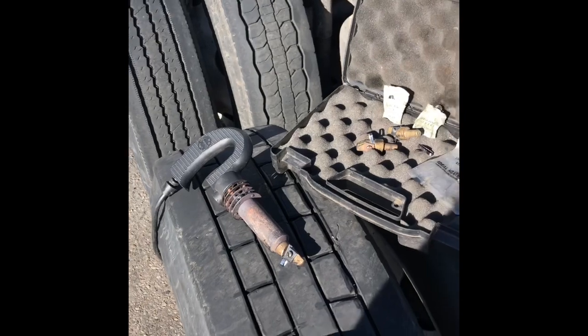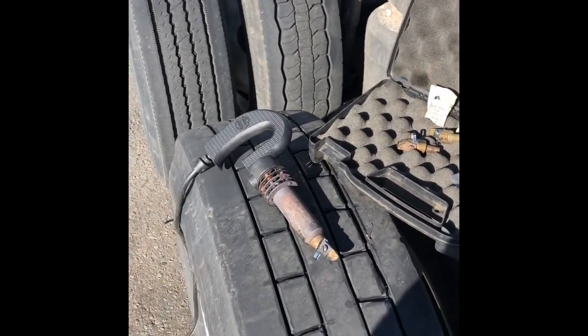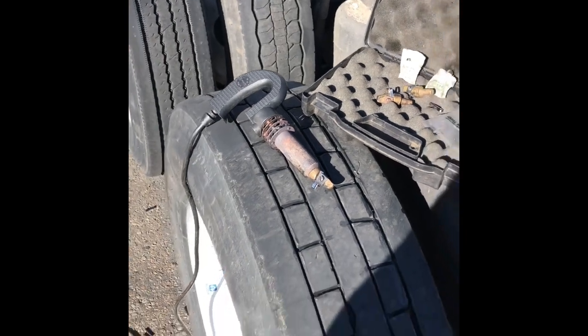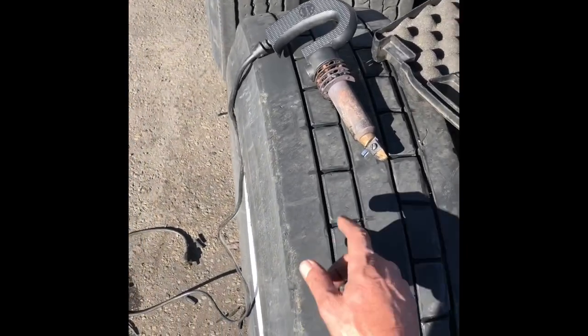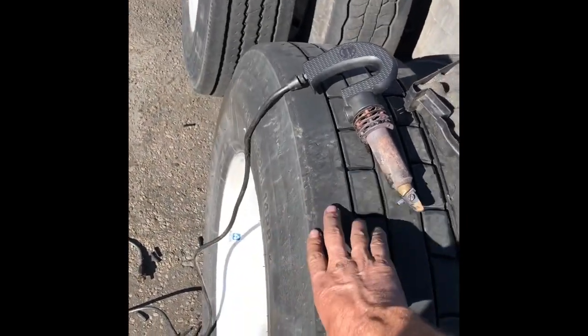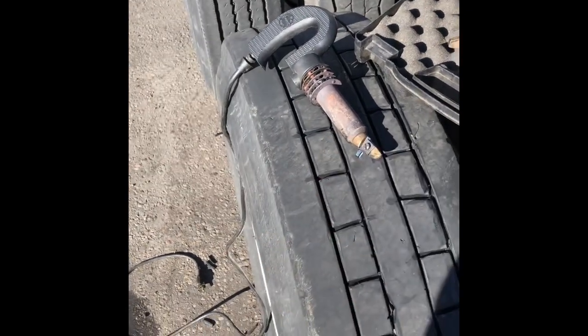The other more practical concern is that if you're not careful — if you don't keep your lines nice and straight and your depths even — you could end up with a little bit of imbalance on a tire. If you cut really deep on this side and shallow on that side, that side of the tire is going to weigh more. Now if you've got the beads inside the tire or liquid balance, it's going to compensate for that anyway.